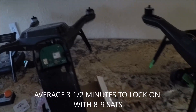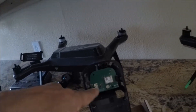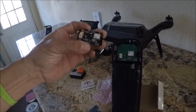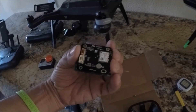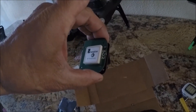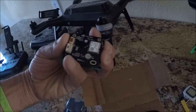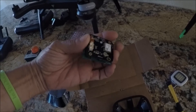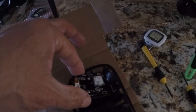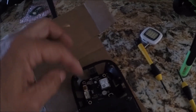That thing used to take minutes to lock on. We're going to remove it. Take these two screws out — it's going to sit right there. For mounting purposes, if you line up the new M-Robotics on top of the 3DR, the holes all line up exactly, so you can't really get it wrong. It goes in the same orientation as the original.